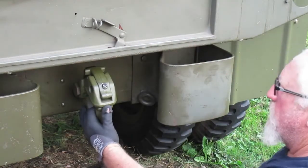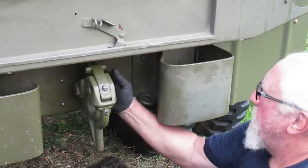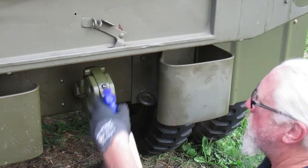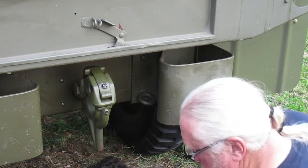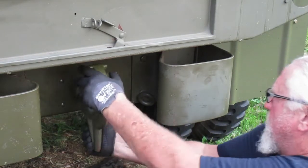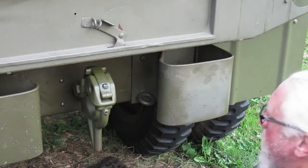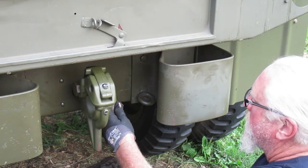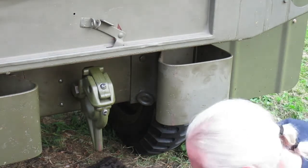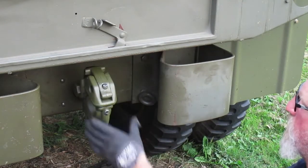The way it's supposed to operate. Lift up on the catch, jaw goes up, the lunette eye of the trailer fits there, obviously. Very nice. Perfect. I'm gonna wait to lubricate it. Like I said, I'm gonna clean everything back here and spray it again. That's pretty good. And this big nut and bolt doesn't have to be gorilla tight, tremendously tight, because we have the cotter pin holding everything together. Yep, that's beautiful.